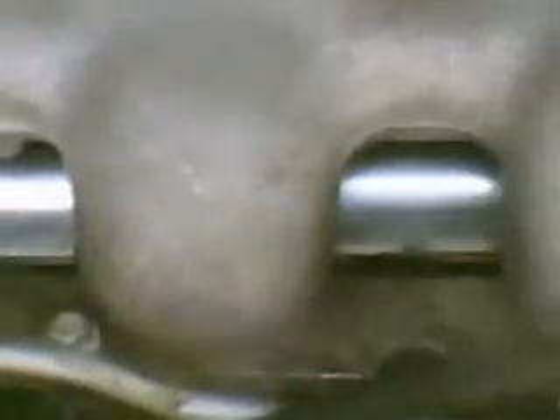One more tip when putting the fuel rail back in: the fuel supply pipe threads were a little hard to engage with the fuel rail. I solved that by raising and angling the fuel rail up to connect to the pipe first, then bolting it down. Other than that there weren't really any problems putting it back together. Thank you.